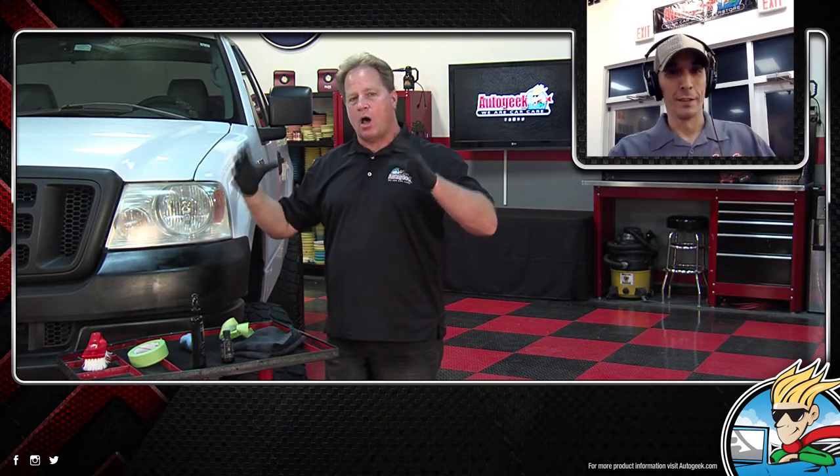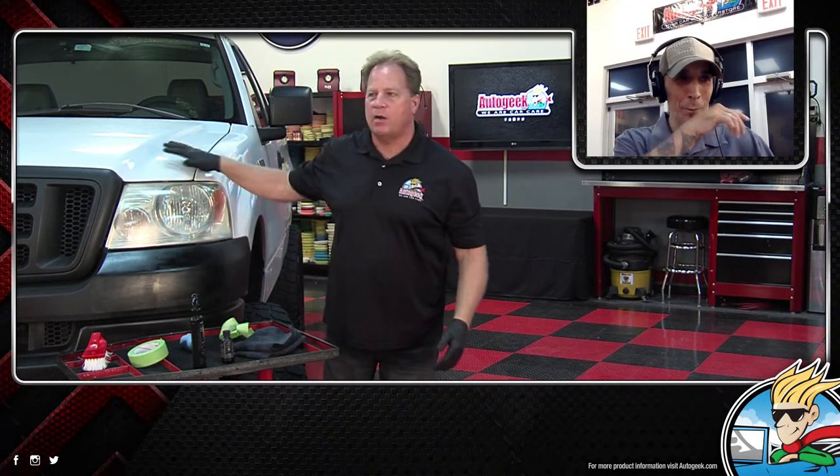Sebastian asks: how long will it last? It lasts up to two years — manufacturer states up to two years. I always tell people how long anything lasts depends on how you touch it. If you wash it with a clean microfiber wash mitt and a quality soap, it's probably going to last a long time. If you're in the middle of the Sahara Desert with sand beating on it, that's going to wear it down. Also, going through automatic brush-style car washes — all you have to do is look at a rental car. Those car washes scratch the paint, and if it's scratching paint it's going to do the same thing to plastic, headlights, glass — everything. You can't run a coated or waxed car through an automatic car wash and expect it to hold up.